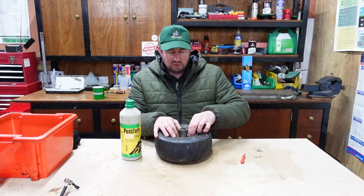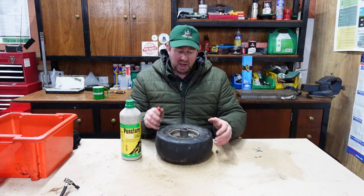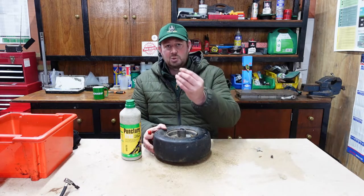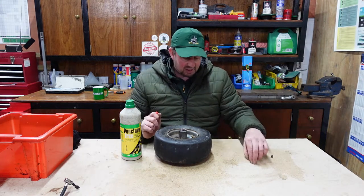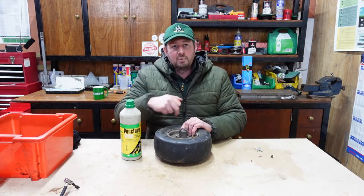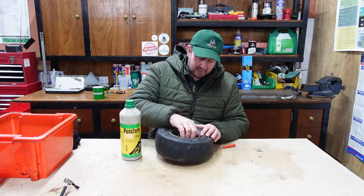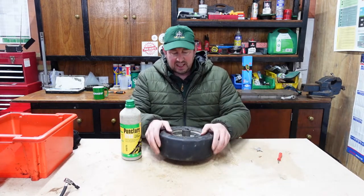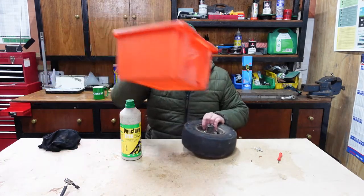If you've seen the videos before, you've seen me use a valve stem removal tool — one of these — and we take the valve out. That's always a good place to start with a slow puncture: just make sure it's not the valve. They're easy and inexpensive to repair. If that doesn't work, you can put it in a bucket of water, look around and see if you've got any punctures. So we'll do that first. I'll put the cap back on — there's still a bit of pressure in this tyre — and if there are any leaks we should be able to see bubbles in the water.